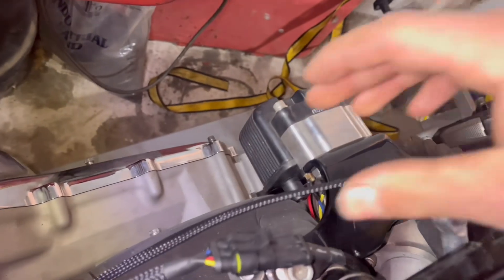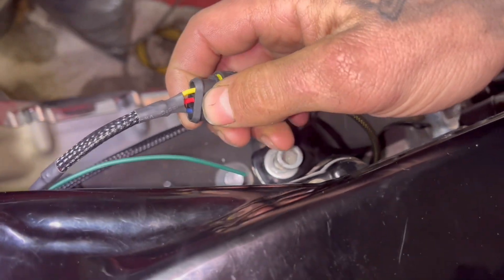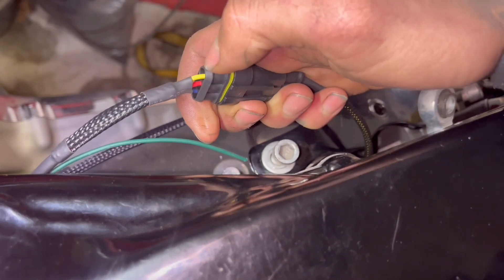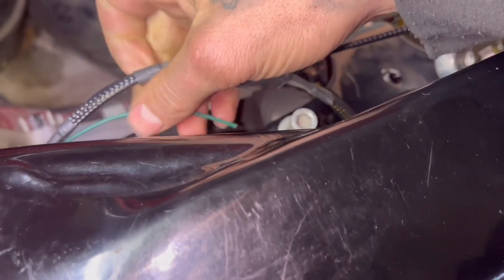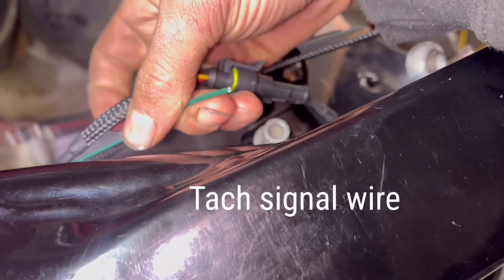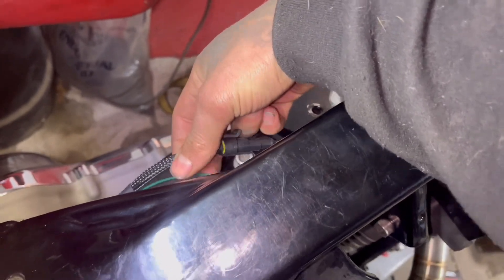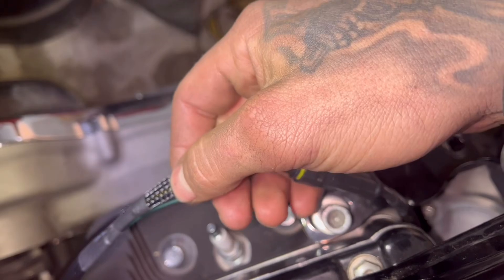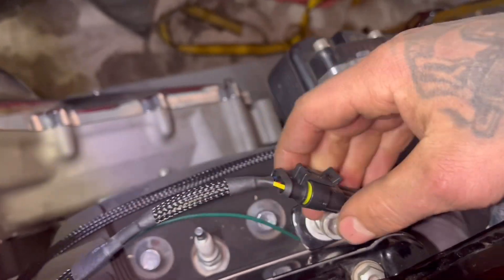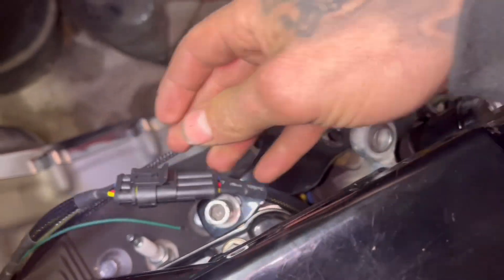Same thing with my coil pack wiring — these are just some Amazon three-plug setups. Red is your power for the coils, yellow is your front cylinder fire, and blue is your rear cylinder fire. The green wire is your tach — I haven't hooked that up yet. I have a tach for it, I'm just waiting on getting a plug for that as well. It's all just Amazon sheathing and heat wrap, but they're waterproof and weatherproof and work pretty well.